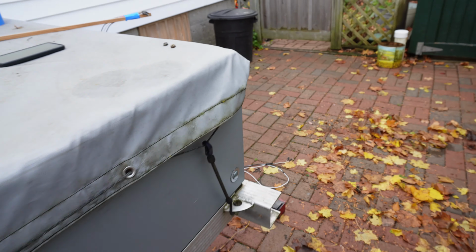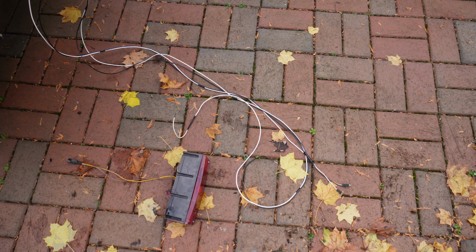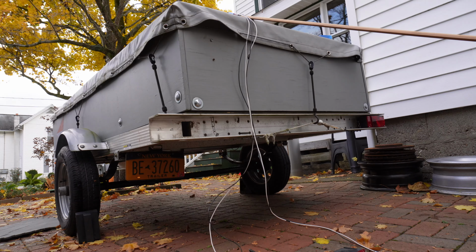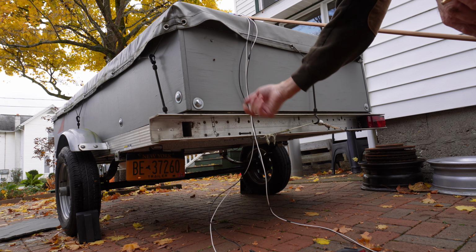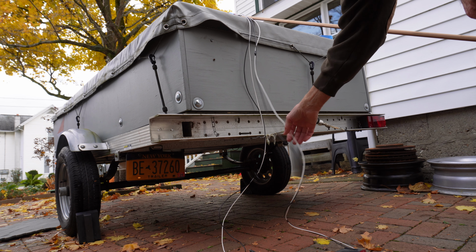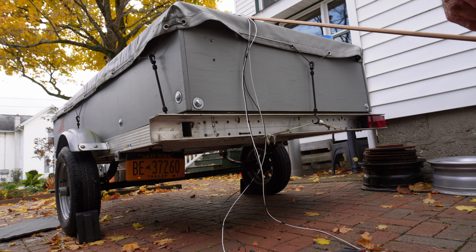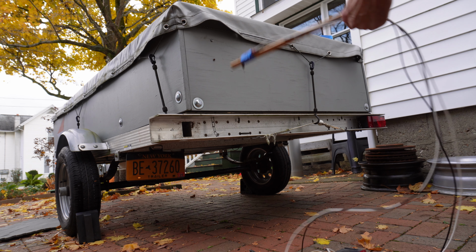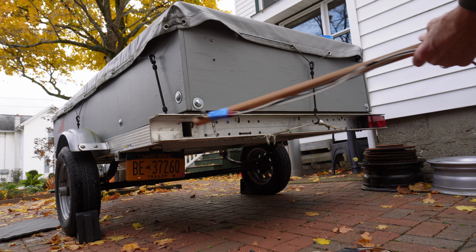This provides to that brown wire the constant power, and it's just a pigtail section that breaks off of this. There's two sections that goes to the license plate light. Alright, let's try and send it through, and then we're going to have to pluck this section that we need to attach to that pigtail out of the hole underneath the trailer. It's going to be tricky, but I think we can do it. These are the connectors that go to the front marker light.